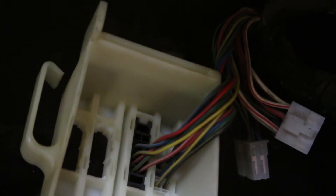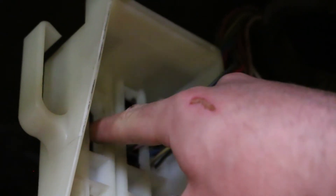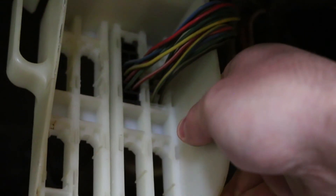What was happening was it just wasn't budging at all — the plastic was in there so tight we couldn't do anything with it. So what we ended up doing was getting a Dremel and dremeling out the sides just enough to get the clips to release on one side. Once we literally put the Dremel on there for about ten seconds on each point on one side, the connection came off no problem. I'd suggest doing everything on the inside first.